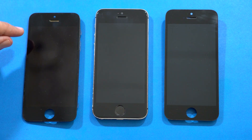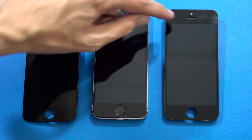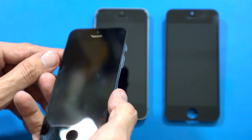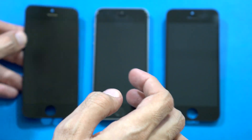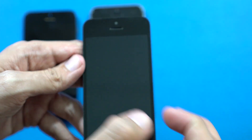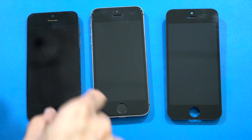The first difference: if you look carefully, the original screen is very dark — almost black — in color. But on these two fake screens, you can clearly see the screen borders and they look more bluish or gray rather than dark black. They don't blend into the body of the phone. On the real one, the color barely changes and the screen bezels are not very visible, but on the fake one you can easily tell it's not the real one.